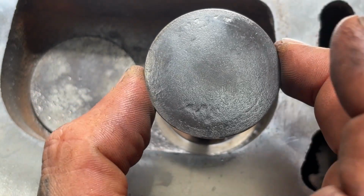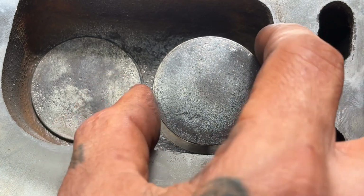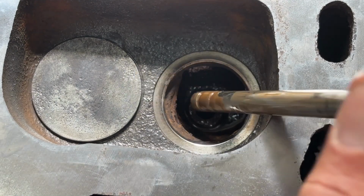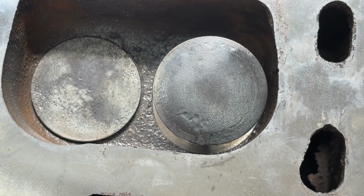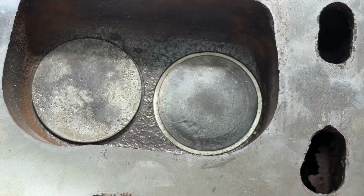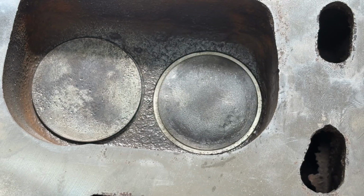Or another way to do it is to bring the valve out and just let it go down like that, because without it, it just pops down like that. Hold your finger over the end. Now it's sealed on the bottom, and you let the valve drop in there. It'll have that cushion of air from your finger sealing it off. So that tells you that there's enough of a seal that that valve guide is tight enough. Just a pillow of air taking her down.